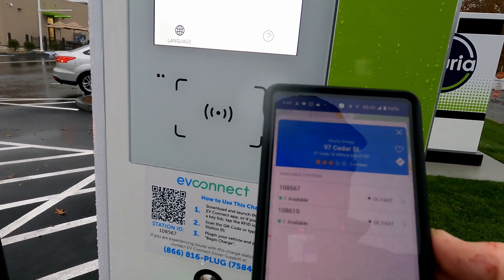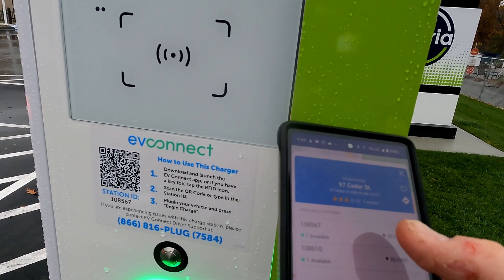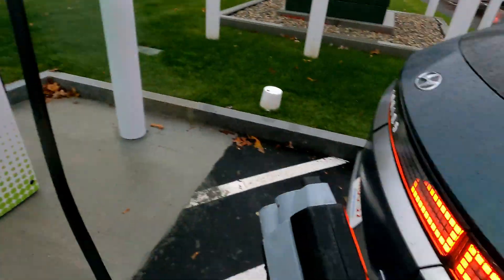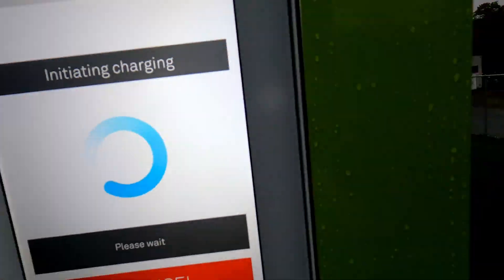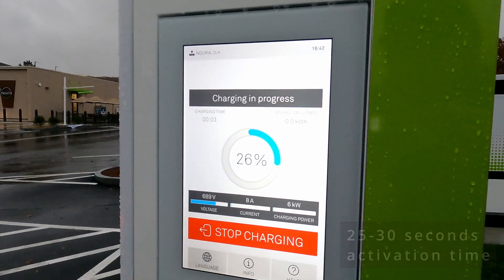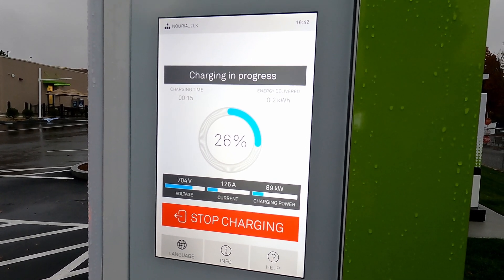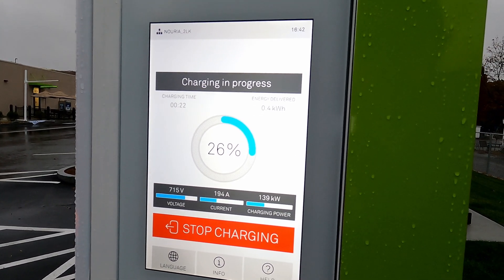So there are two chargers here, both say available in the app. Slightly disparate numbers — this one ending 67, the other one ending 610. But we know which one it is. 320 kilowatts, so about as good as you're going to get with these big chunky CCS connectors. We should be good for more or less full power if these can deliver 320 at max. And we have a warm pack — warm as it's going to get. It's not quite as low state of charge as you might want, but we're going to get most of what the Ioniq 5 can take, as long as this charger can give it.